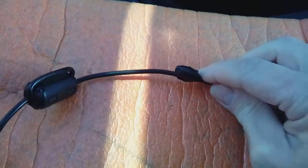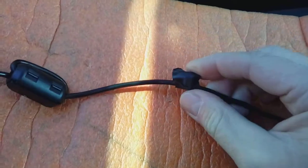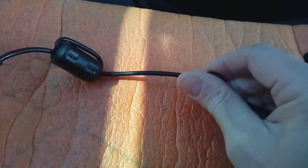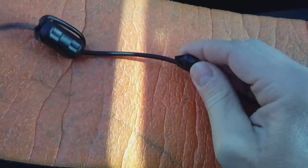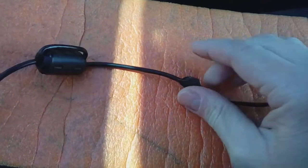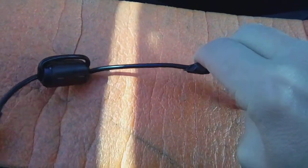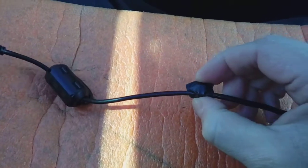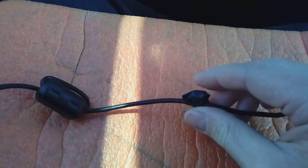Next thing I've done, which is a matter of preference, I always do this, wrap a couple of cable ties around the cable, snip them off and cover them in electrical tape. What this is for is, with it being tucked above your headlining, if you hit a large pothole, the last thing you want is the cable to come dangling down in front of your view while you're driving along. Not ideal. This just beefs the cable up enough to give it a bit of weight and stay up there behind the headlining.